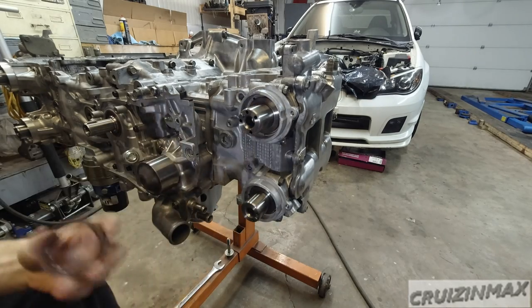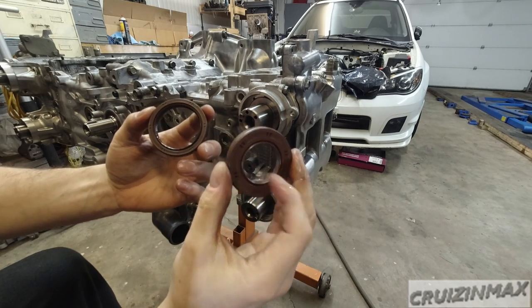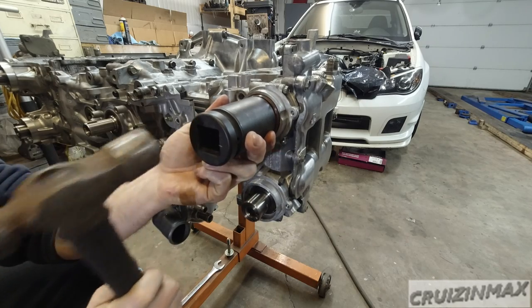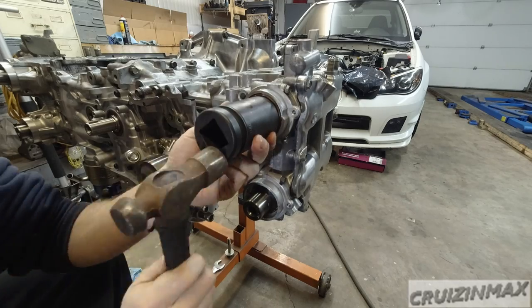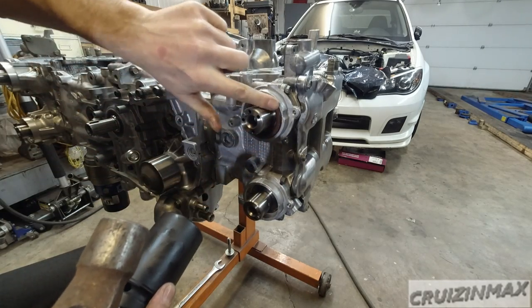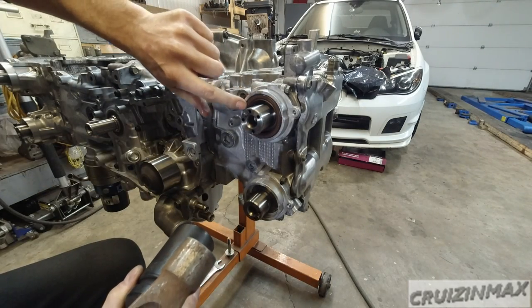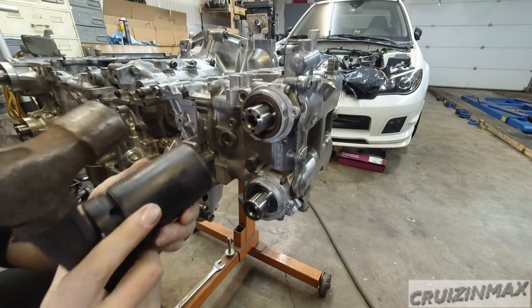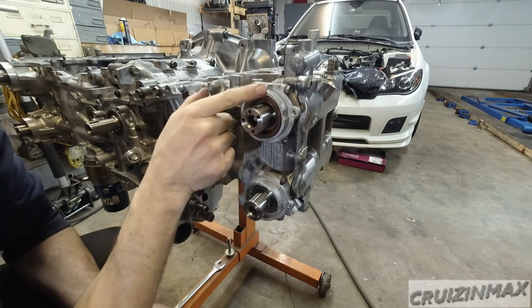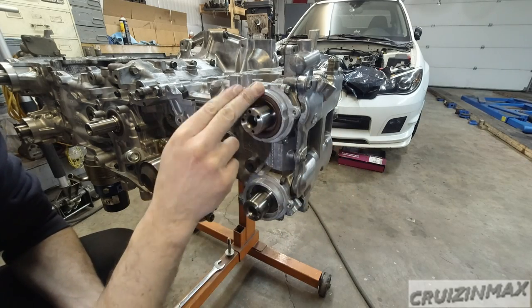Outside and inside, there are two different seals. The ones with the bigger opening are for the intake cams; the ones with the smaller opening are for the exhaust. I keep taking it out and checking — I don't want to go in too deep. I want to be flush with the outside surface of the head. It's flush on the left side, but there's a sharp edge so one side sticks out a tiny bit — I'm going to leave it like that.